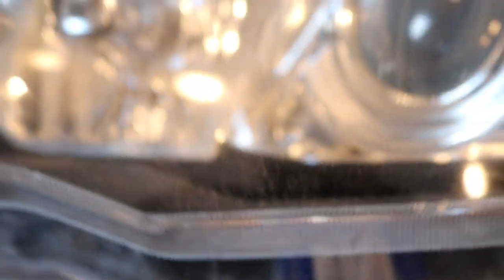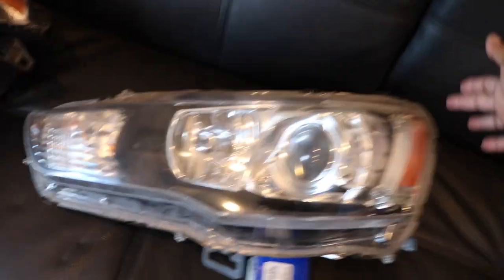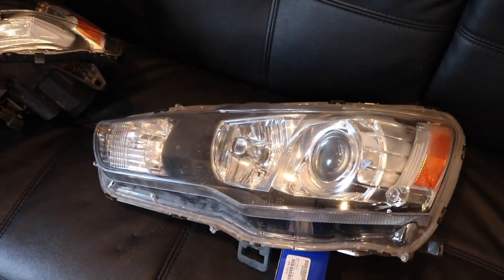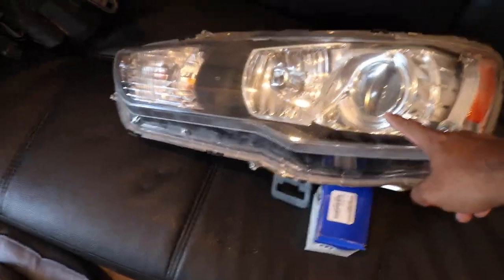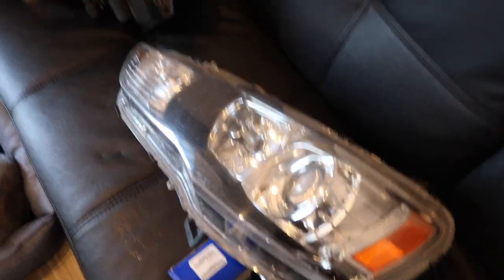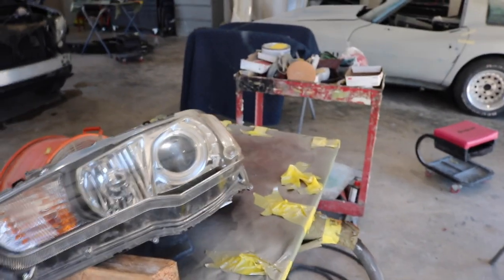That's my goal, because I'm pretty sure I can get it as clean as these ones over here. The reason I want to use an OEM headlight — with the lenses, if you look right here, the aftermarket ones say something else, but when you're selling a vehicle a lot of people look for the Stanley logo. You can see the Stanley — it's a little hard to read, but once it's nice and clear, man, these lights are worth some money. I haven't messed with the factory seal — all the factory seal looks good. I'm going to sand this down and re-clear it, and all the internals are good, so it's just the outside lens. A little project to see what a wet-sanded, re-cleared headlight looks like versus a lens replacement.